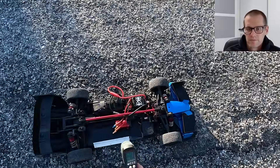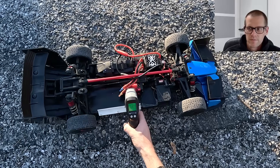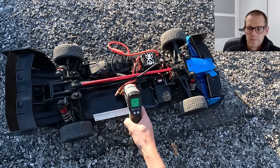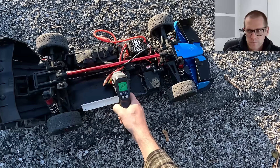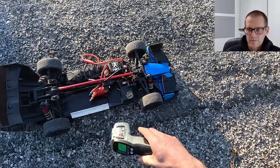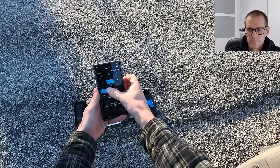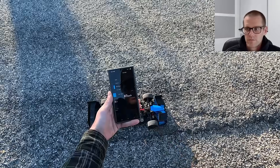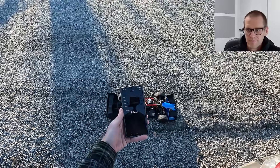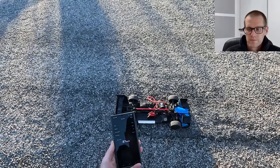We get the temp gun on it and read 69.71 degrees. Definitely hot — one run and this thing is cooking. I wouldn't want to go a second run without letting it cool down. I'm going to unplug it and see what speed we got. We got 87 km/h — so 88, now 87, as opposed to the 117. That's a massive difference in speed between our low KV motor that just struggles to get off the line and our high KV motor.